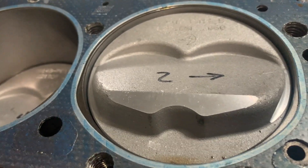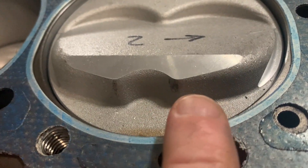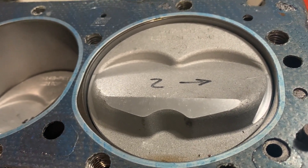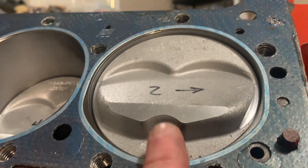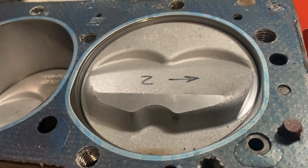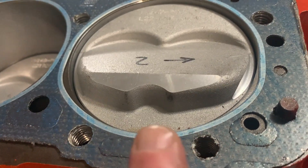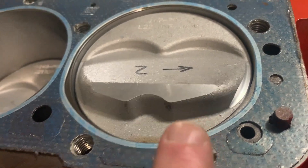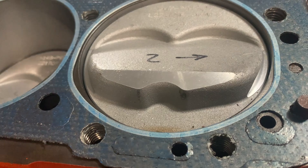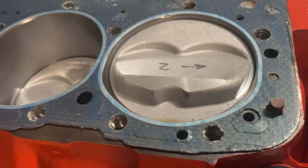The easiest way to figure out the chamber shape — play-dough, right? We're going to use some play-dough. We'll figure out what the chamber is supposed to look like and how much needs to be taken off the piston. We'll have a good idea of what area we need to take as much off as possible. I'm going to mix these three colors together. I do this quite often — it's the simplest and easiest way to do it. It doesn't cost much, about $3.75 for five of these. It's the easiest way to measure something like this and figure out what it needs to look like.